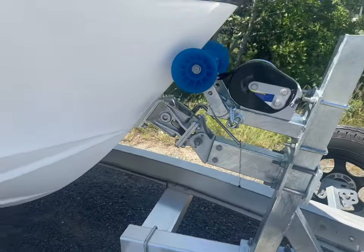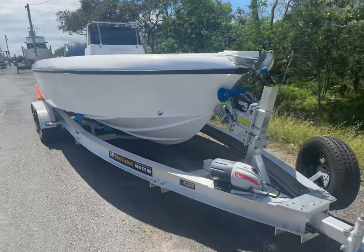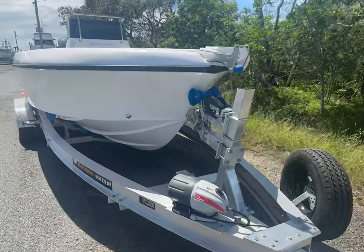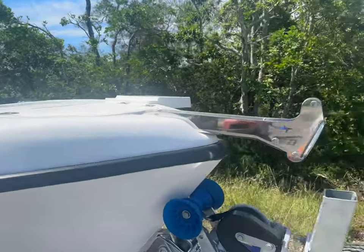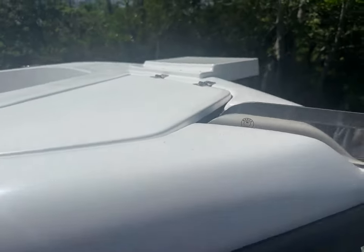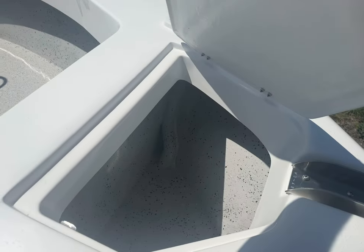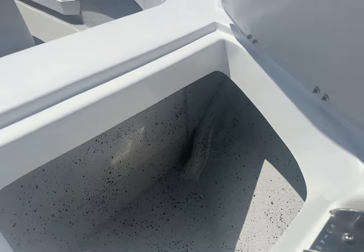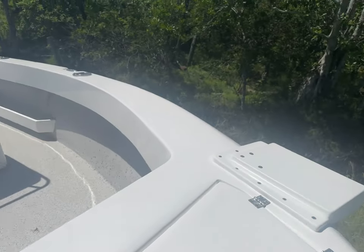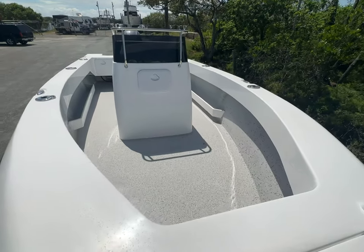Up in the bow, on the three-ton Azielo trailer, we've fitted a boat catch. There's a drain here for your anchor well — that's standard. It's a three-ton Azielo trailer with drive-on, drive-off Alko electric-actuated brakes. We've installed a bow spot that Brett supplied for us. Up in the front we've got the anchor well, all reinforced, with a rigging tube there for your electrics and anchor well.